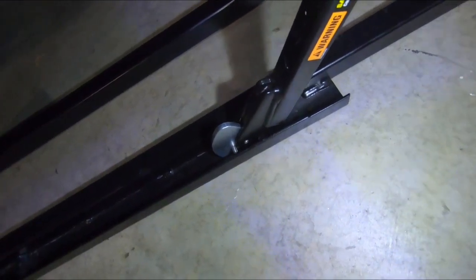You shift it down a little and there's like a little groove here. When I'm ready to raise them, you would flip this piece up and lower them back. So this just means if the hydraulics fail, you should not get crushed. So let's go under the car.